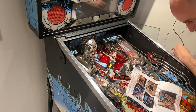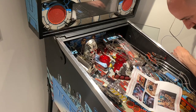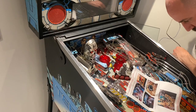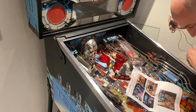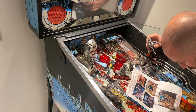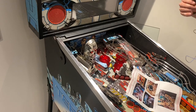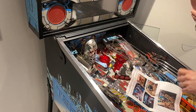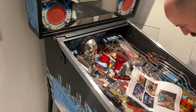Feed the cables between the plastics underneath the ramp and through the hole in the playfield. Remove the screw on top of the plastic ramp, bend the bracket as desired, mount the mod on the ramp. Picture three. Pull the excess cable through. So if I look on the last picture, I can work out which the longest wire will need to go. So that's below here, that's down to here. So the longer wire is going to want to go down.